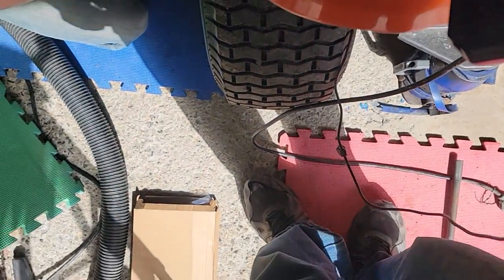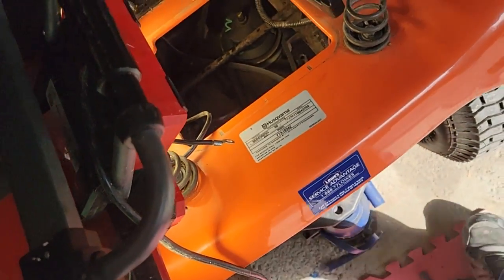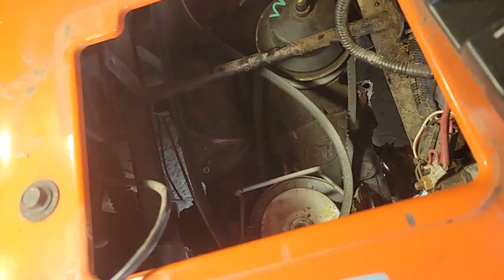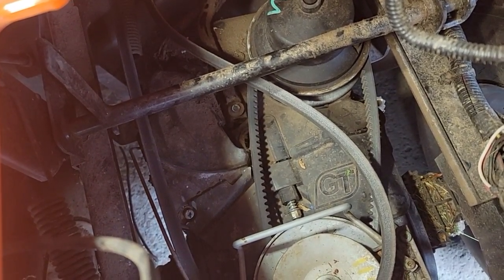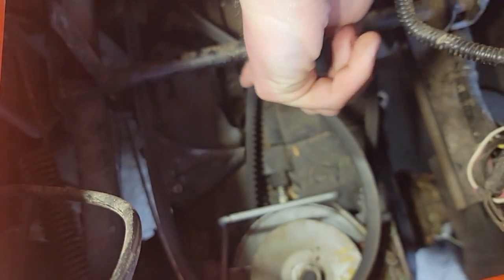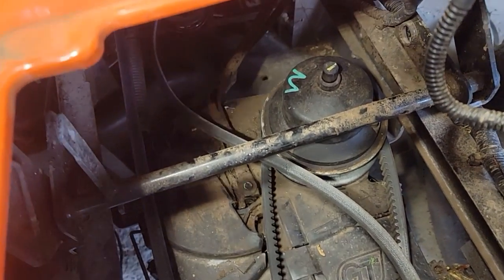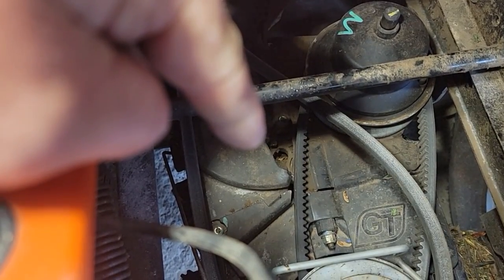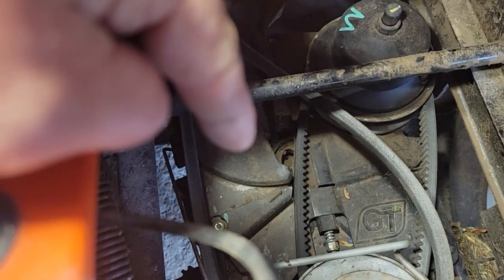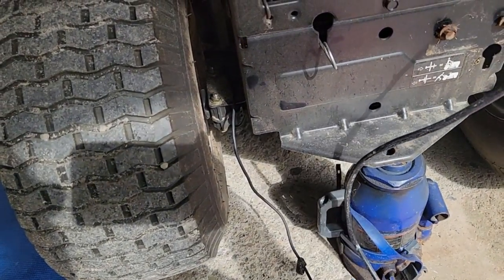So I want to look down in here at the transmission. This has got that GT transmission and if you look really close, right there at the beginning of the movement, I don't know if I get the light just right, there's a little shiny spot like something's rubbing. We're wondering if there's a little bit of debris there — just barely pressing it, you can see the back and forth play just about when you start to move it.